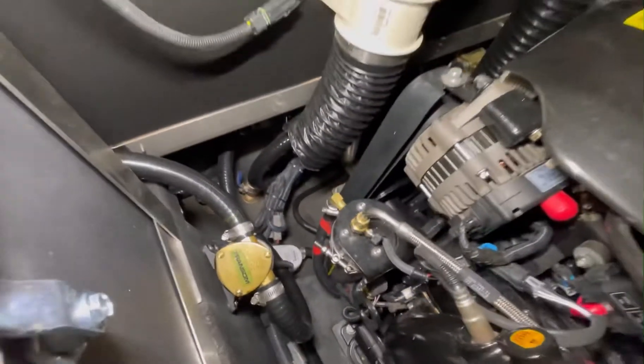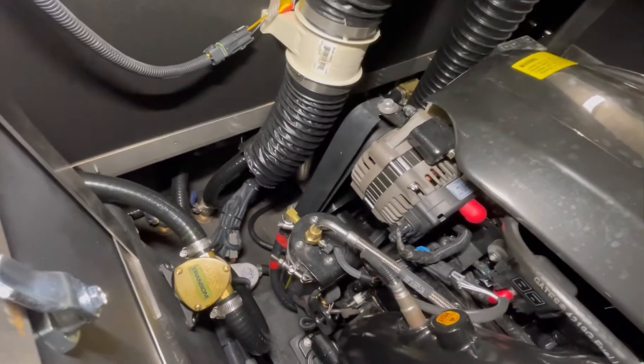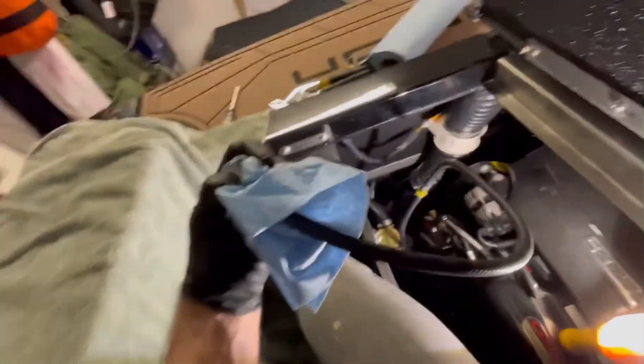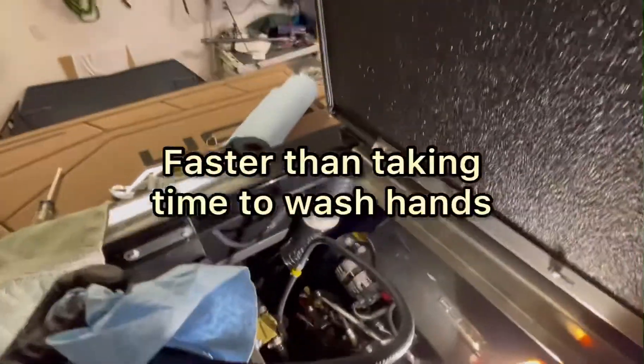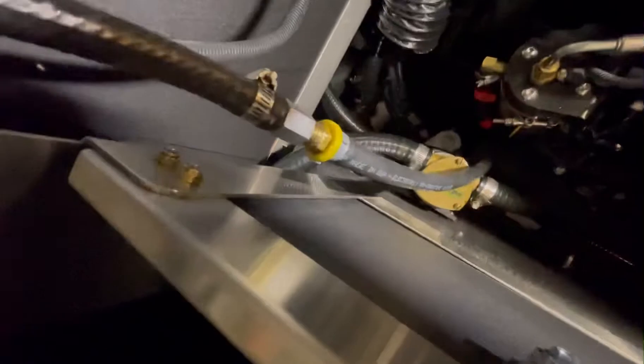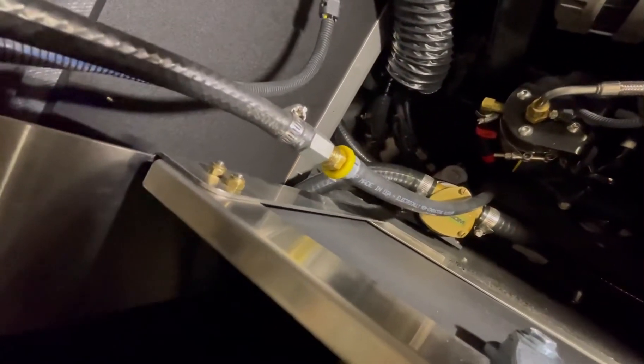What we're going to do right now is pull that oil drain hose up — it's still connected to the fuel hose from Napa — then remove that and secure it. Here's another tip: put lots of towels down. You don't want to destroy the vinyl in your hundred thousand dollar boat. Wear gloves so you can take them off and change them between jobs — I'll pull these gloves off after I secure the hose. Here's the top of the oil drain hose, the yellow part, and the air chuck or male air connector there on the fuel hose from Napa.